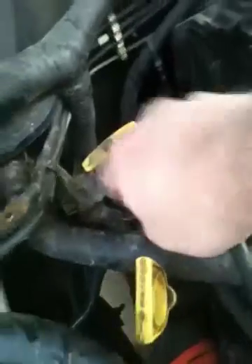This hose going to the heater core is hot, but this other lower hose is not. The top one going back here is warm, but this bottom one is like there's been no water running through it at all. This one's hot though. Stumped. The water pump area is hot.